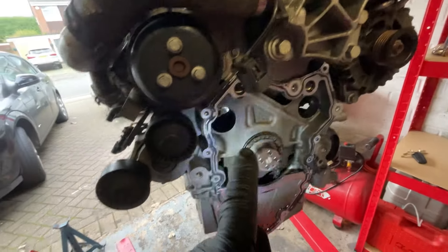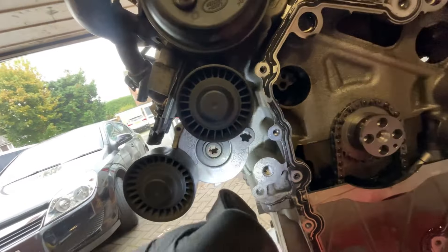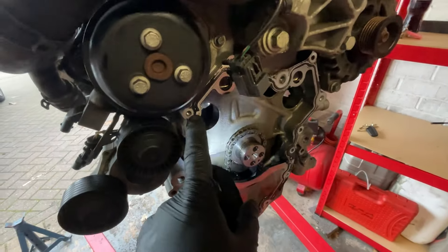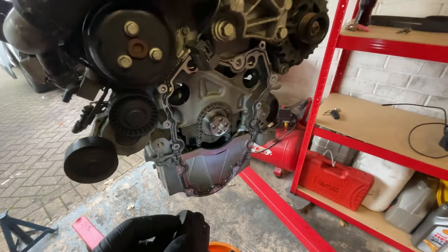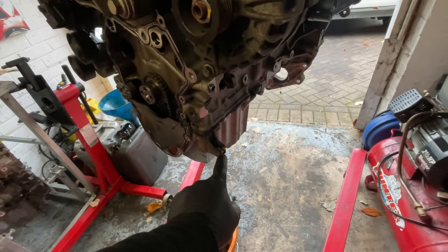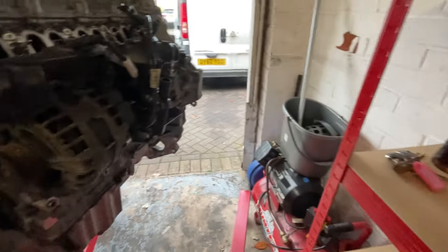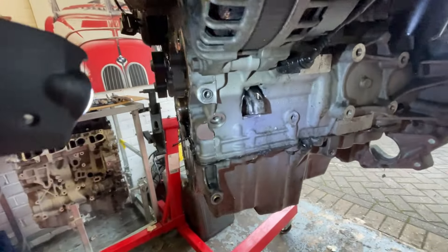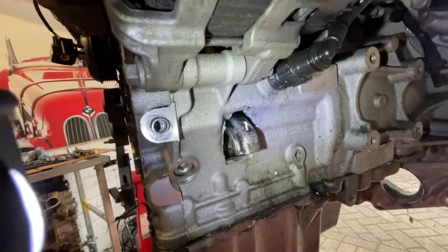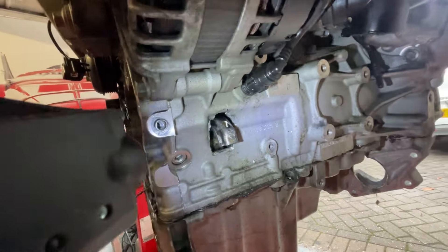I had to remove the front cover as well, so I just took the belt off - you put a part in, turn it, it takes the tension off, and you take the belt off. I took the pulley off the front, which is just four bolts and some eight mils. As I was starting to take the sump off, there was a bolt that went through here. As you can see, here's the compressor - I had to get the air conditioning compressor off - and as soon as I took the air conditioning compressor off, we found the problem. That is an actual con rod - it's gone through the side of the engine. This block is completely totalled.